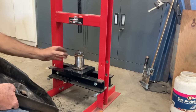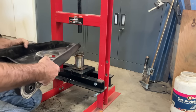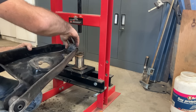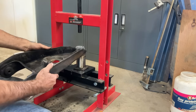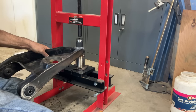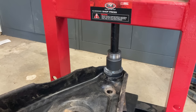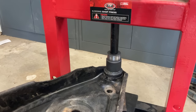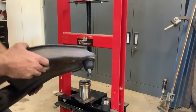So all we're doing is putting the exhaust tube with the plate flat on the base, because these have got a lot of shape in them. They rock around, so I prefer to do it that way. So your ball joint, start him off just sitting there. I might have heated that one a bit much. He's sizzling. Make sure that's in there. A big socket. If you see just there, in he goes. That's our ball joint.